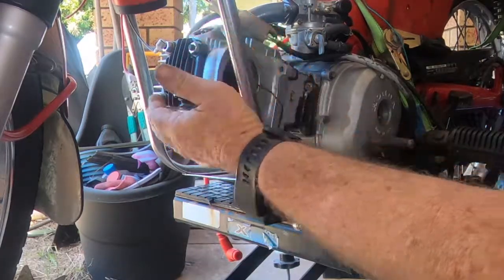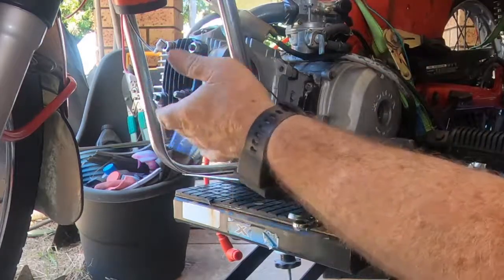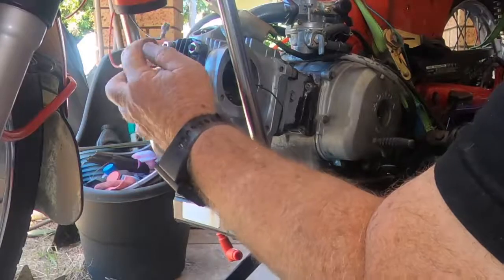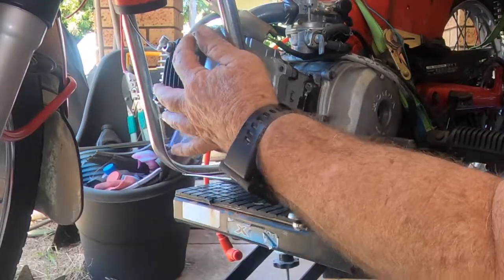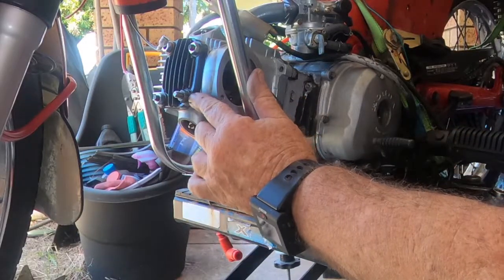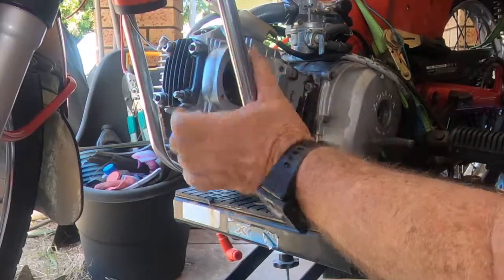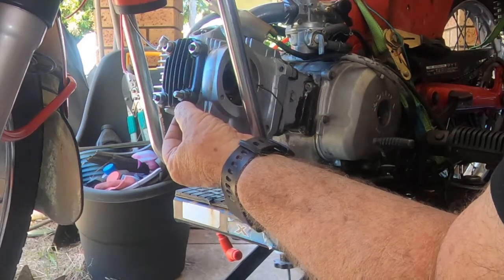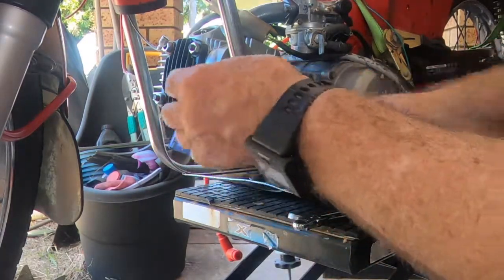The nuts he's got on here aren't the right nuts anyway. There should be two dome nuts and two flat nuts. Two dome nuts should be there and there, and the flat nuts there and there. They should have a washer under each. There's no washer under that one. There's a washer under, and that one is actually a shoulder nut. So I don't know where he's got his bits and pieces from.